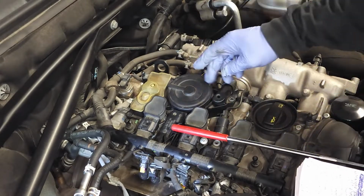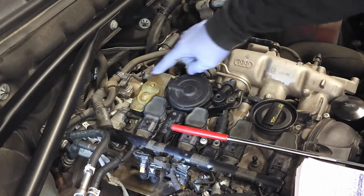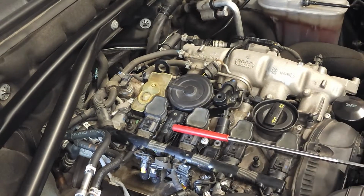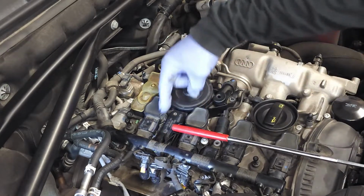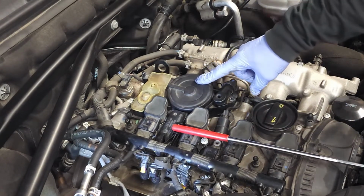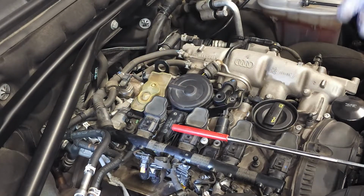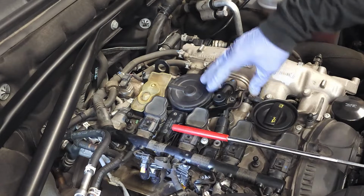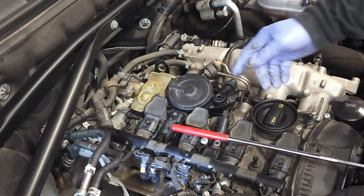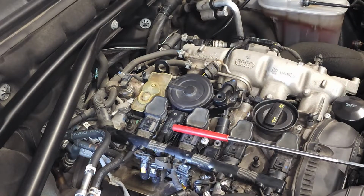It's your choice. I'm going to put the part number for the diaphragm in the description below, but it would be my recommendation to just replace the whole part because the rubber gaskets do get hard over time. There's a lot of vacuum involved here, and it only takes one weak spot for this whole thing to fail. Say you replace the diaphragm in January, and then the gasket goes bad in March. Now you're using twice as much time, and you're replacing the entire part at a more expensive cost when you probably could have saved the 15 bucks you spent here and the time that goes with it.